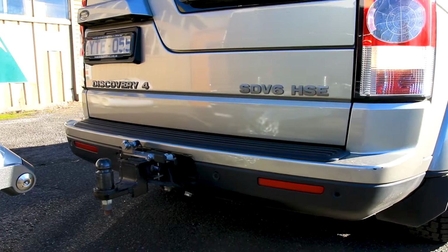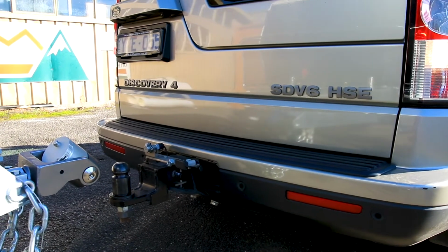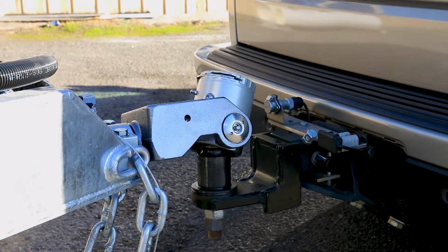There's two ways of linking up Hitch Ezy, both are equally easy. One, you can reverse into it, where the mouth of the coupling faces the incoming tow pillar head, and as you reverse in you can see the coupling rotate, and when it gets to vertical or near vertical you know you've backed far enough. Simply get out and drop the coupling down, it'll be fully engaged.